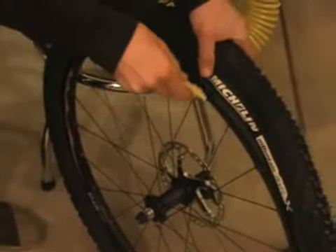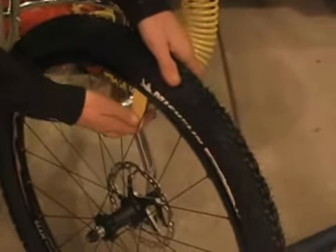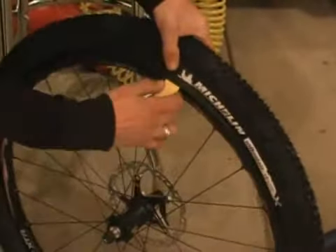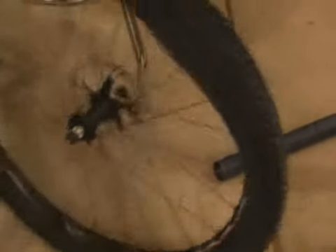You can kind of see there's a little bit of a hook under there to attach it. Then you want to push the wire bead, push the lever down, the wire bead over the rim. Once you get that, you want to just slide the tire lever down the rim, and you can see it pulls the wire bead off. It should be pretty easy to do — some tires are a little bit harder than others. Then you need to continue to get the bead off the rim completely.